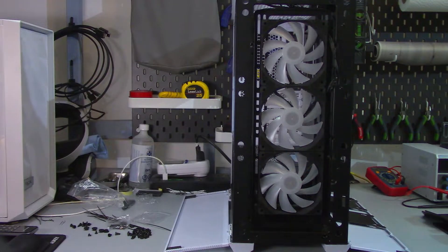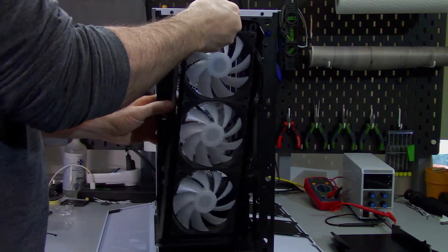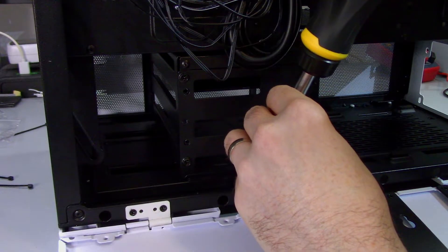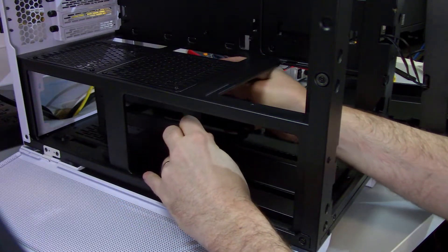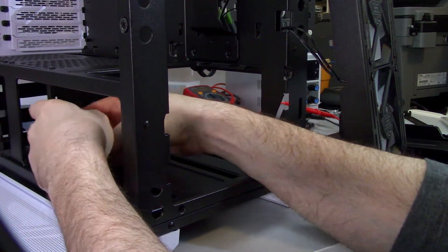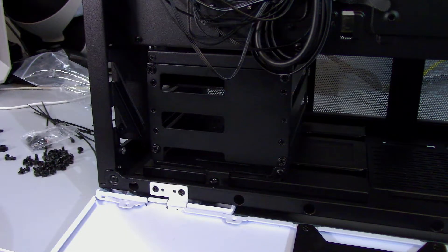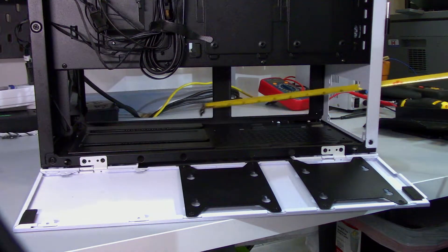To remove the drive cage is more complicated. You first need to remove the front panel and the front fan tray by undoing two screws — one on each side. You also need to remove the shroud cover by unscrewing one screw on top. Then, with the cage unfastened, slide it all the way to the back out of the rails, rotate it, and bring it out through the front of the case. With the drive cage in the frontmost position, there is 280mm for the PSU and cables, but a 360mm radiator can no longer be installed. With the cage removed, there is just over 400mm, though a 360mm radiator will reduce that.